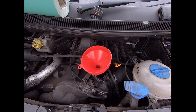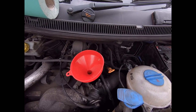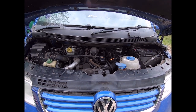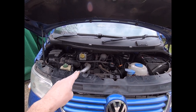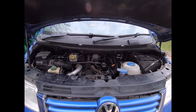Pop the funnel in and we're going for eight and a half liters. You want to pause at about the halfway point just to give the oil a chance to sink right down into the sump and then check for any leaks at the oil sump. Once filled with eight and a half liters, put the intercooler pipes back together, the circlip on, the power steering reservoir back in place, and check for any leaks before you start the engine. Then you're good to go — thank you for watching, I hope you found the video useful. Please like, comment, share, and subscribe to help other T5 owners out there. Take care.